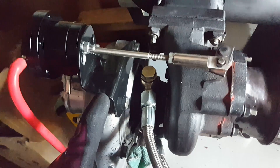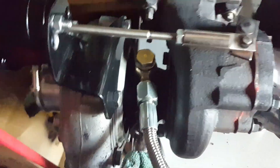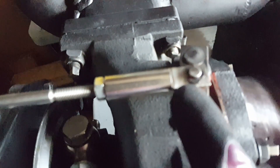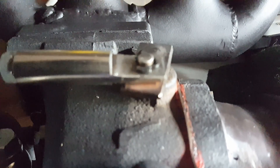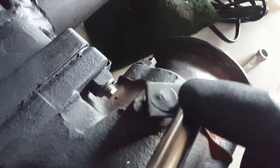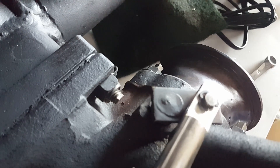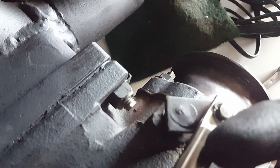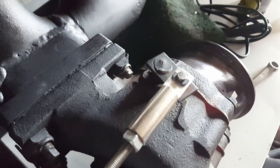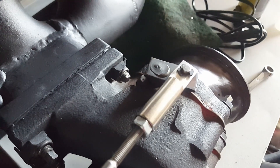The turbo is all assembled - brackets on, actuator on, rods connected. I thought I should test this before putting it on the car to make sure the flapper opens and closes nicely. This connector to the flapper was a little bit too thick so I've ground that down to get it to sit nice on there. If you watch this flapper open and close now, you'll see that when it opens fully there's a problem: there's a shoulder here and the same on the bottom, and that shoulder is actually hitting the wastegate penny. I'm going to modify that and make it a little bit slanted so it doesn't get in the way.